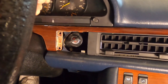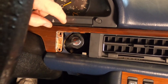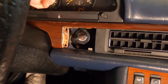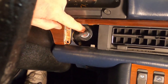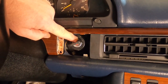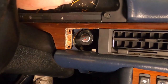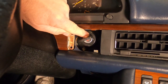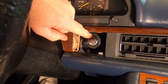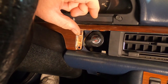In order to replace this thing you're going to need a tool, which I'll talk about in a moment. First, you're going to disconnect your battery. Then you're going to take the key and turn it to the accessory position — position number one, which is analogous to the radio coming on. You'll see a little hole there. You're going to place a very slender piece of metal down in there and disengage a spring-loaded clip, which allows you to extract the cylinder lock. Once you insert the tool and depress the spring, you turn the cover on the exterior of the cylinder lock counterclockwise, and it draws the entire assembly out in one piece.